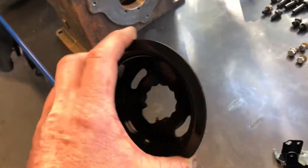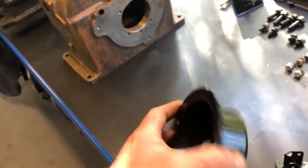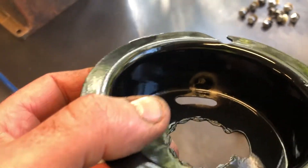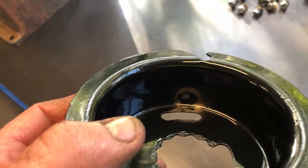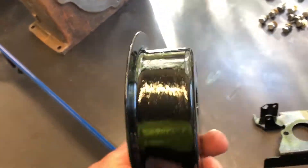Give the pull start pulley a bit of a powder coat. Trouble is you can see in there where it missed a little bit — that's where the hook was hanging it up. It creates a little arc around it and the powder won't actually stick. So we'll just touch that up with a rattle can of black.